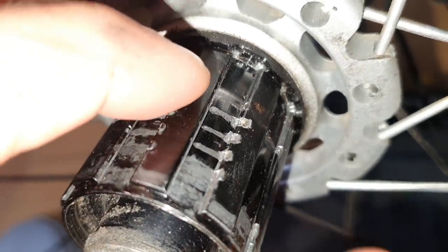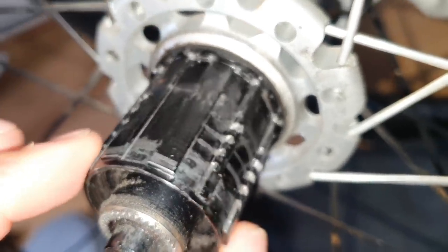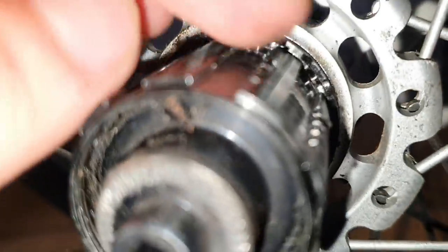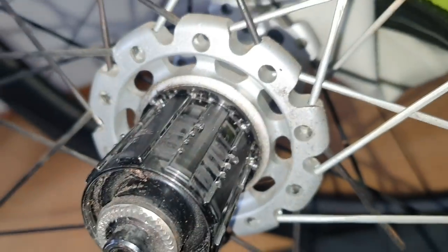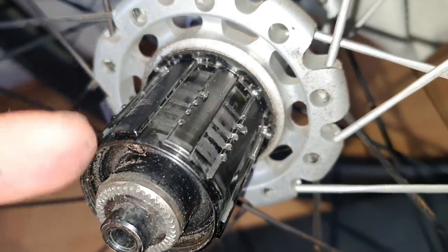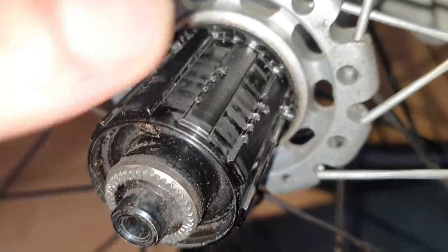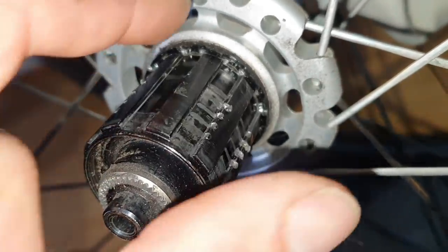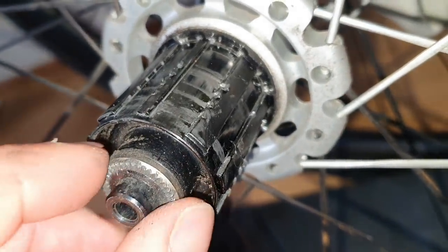Someone's put a cassette on here a bit loose, so it's set some burring. What you're going to do is get a file and just file it off — good as new. Because this is a DT Swiss hub, you can put an 11-speed on there or whatever you want. If you find that burring, it'll reduce the market value for most people, but for me it doesn't matter — just file it off. If you're using SRAM one-piece cassettes, it'll also bite a bit. Just make sure you put your cassette on tight enough. You can also get a long industrial staple and slide it in there — that'll prevent the cutting. A lot of hub manufacturers these days like Bitex and Novatec will put a little metal sleeve in there to prevent the biting. Just a little quick tip — still fine, good to go.